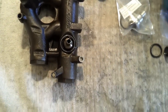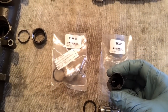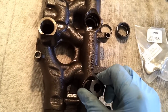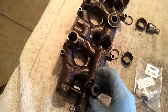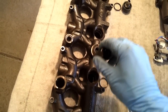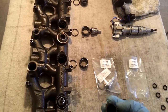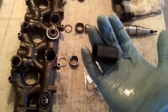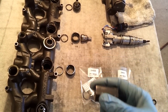You are going to need ISK607, or another tool. This tool has a cavity to go around the nipple cup and engage the hex ring. It also has the added benefit of acting as an alignment tool — when you're ready to put your oil rail back in, just put it on each of the nipples, it'll make each nipple perfectly straight, and you know you're aligned and ready to go, avoiding damage to your injector O-rings during installation. It's a good tool for any 6.0 liter owner, and that's $59.